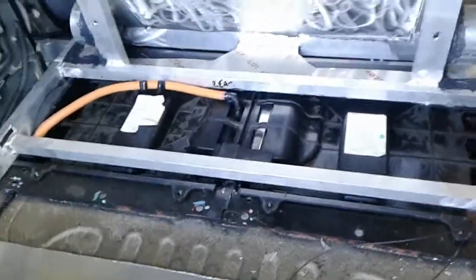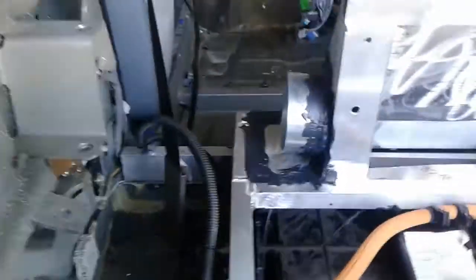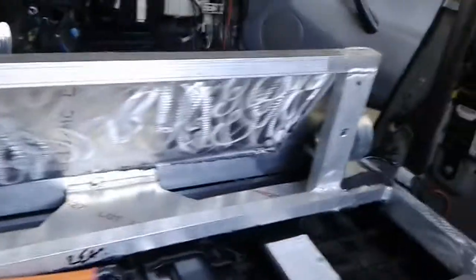This is the chassis for the battery box. There's the lower battery down there — it's about 150 volts of battery. The way we've designed this, there are going to be fans down there that pump outside air in through the ductwork. Those holes there actually go down into the lower battery box and then come out right here, which is going to fill this chamber with air, with the main box sitting on top, and then take all the air out through a hole in the body out to the environment. The idea is we're going to move a lot of heat as fast as possible so this thing doesn't overheat and it can actually drive 150 miles on a charge like it's supposed to.